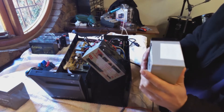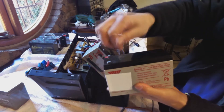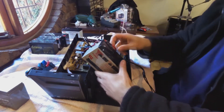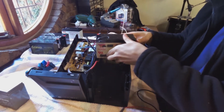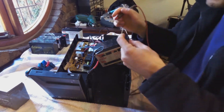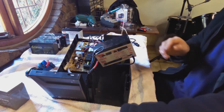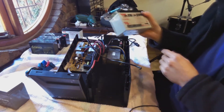There is a way of actually servicing the battery — you can cut it open and refill it with distilled water — but I'm not going to do that. I'm just going to measure this second battery and see what it's saying. Four volts. This one is even worse — four volts. This battery is actually done.